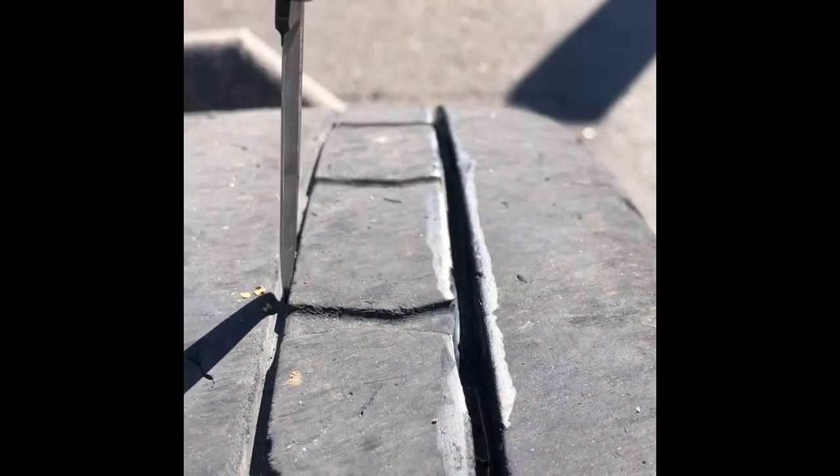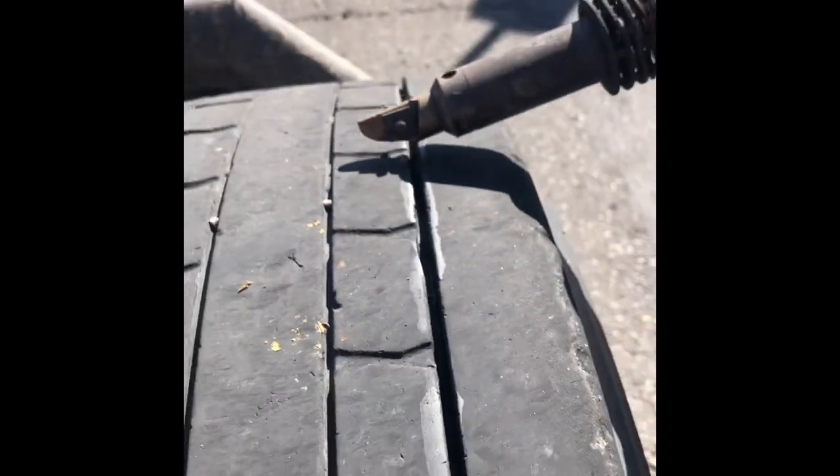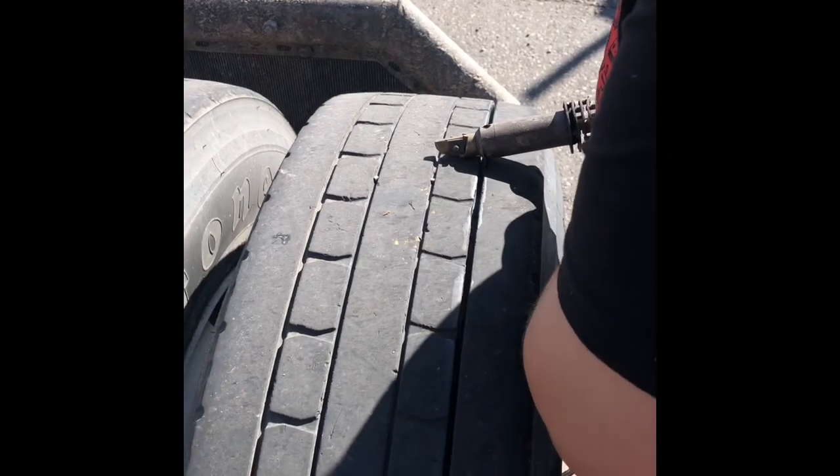Look at the difference right there between this groove and this groove. That's basically pushing the edge of legal limits, and there we've got a nice deep groove again — we can actually go deeper than that, but that's where I've got the setting set. We're going to roll with that for now; maybe later I'll re-groove it a second time.